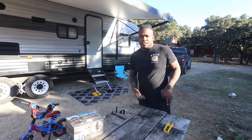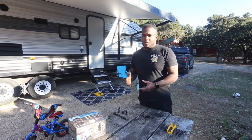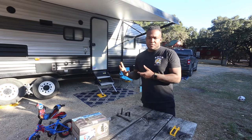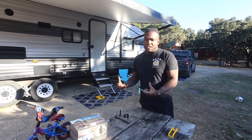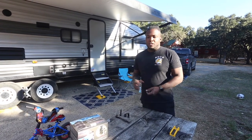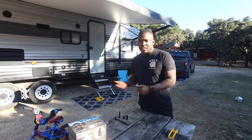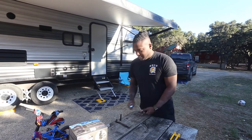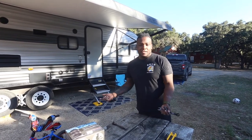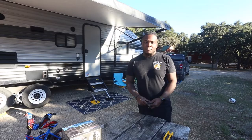Hopefully this helped you guys out with your install — prefab it first, then put it on your truck. On my truck, because I have a leveling kit and the front sits a little higher than the rear, I did have to jack up the rear end and let the suspension hang so the Timbrens would fit pre-fabbed. I hope this helped — if you've got any issues put it in the comments and we'll try to get back to you. I only installed these on an F-150, so if it comes different on another vehicle I can't fully help, but thanks for watching — like, comment, subscribe, we'll see you guys next time.